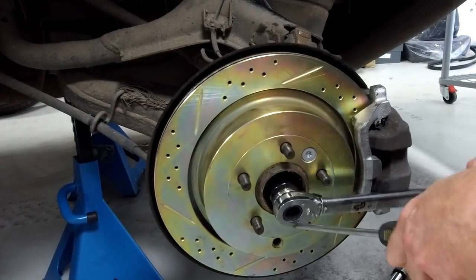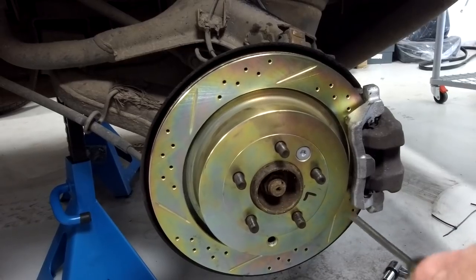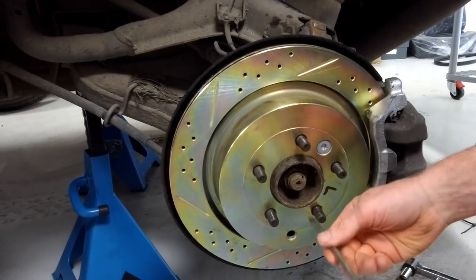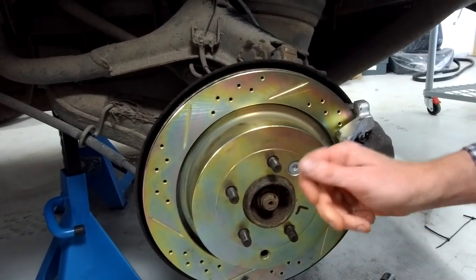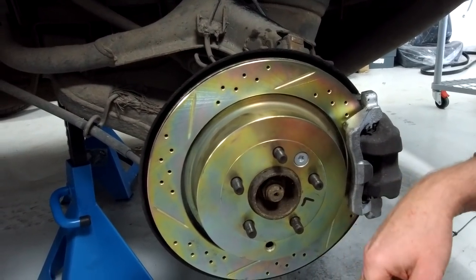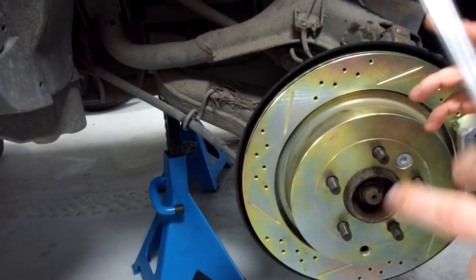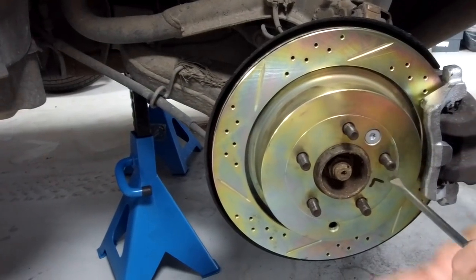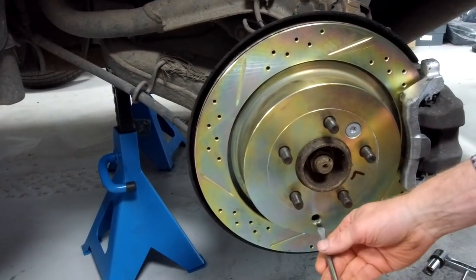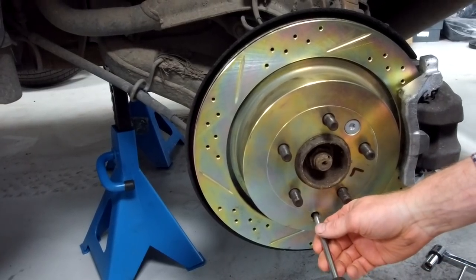It'll start to move without, so you could get the torque wrench out and do it like he's saying, but I'm suggesting just do it as tight. We found the difference between the torque wrench moving and not moving was one click off, as tight as we could do it. So you just do it as tight as you can. The manuals love measurements and torque settings, but in real life I think you do it as tight as you can, back it off, and then the manual says back it off 8, so I've got to spin it up.